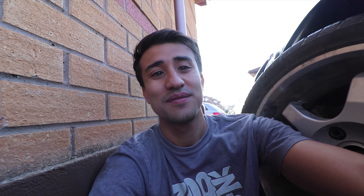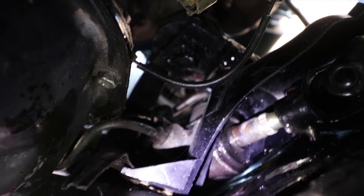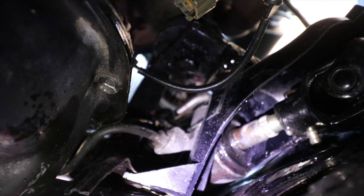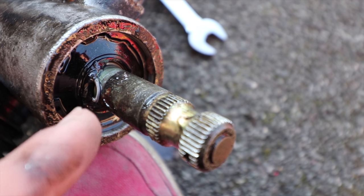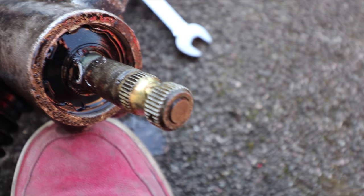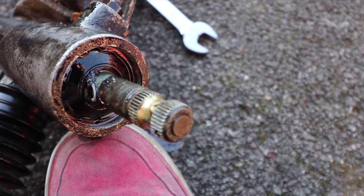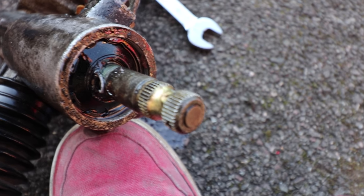Let's have a look. So it was leaking from that area. I must have plumbed this up wrong and that's why it just blows out the seal each time. So that's the new rack, as you can see — it's kind of shut itself there. I'm going to pull this off and see if I can just fix it, because I think I put the high pressure line on the low pressure port and vice versa, and that's what's causing this to blow out.